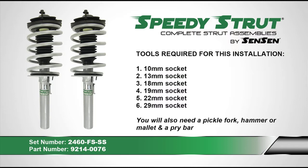Some of the tools needed for this installation include 10, 13, 18, 19, 22, and 29mm sockets, a pickle fork, hammer or mallet, and a pry bar. It is recommended to use a torque wrench for proper torquing of bolts. However, a lot of experienced mechanics believe they have the ability to feel when it's tight enough, so we leave this to your judgment.